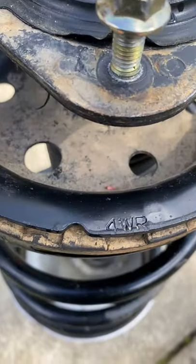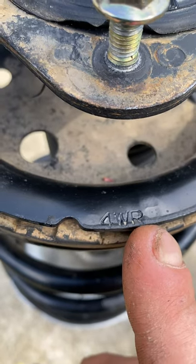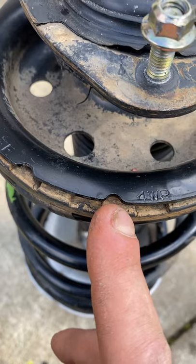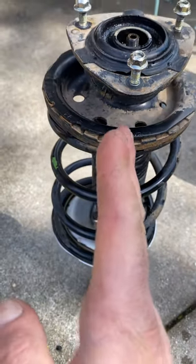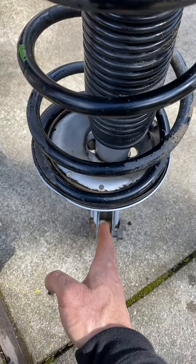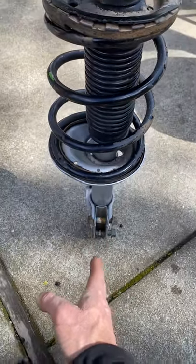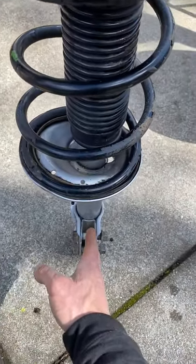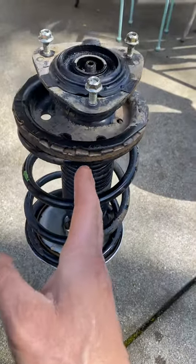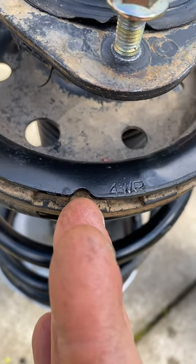Just a quick little example of how you want to line these up. This is for the rear right side — there's a little notch right here, right next to it. That little notch is in a perfectly vertical plane with the two mounting bolts and the mounting face that slides into the rear spindle. So basically, line up that lower mounting plane, go perfectly straight up in a vertical plane, and that should line up with that little notch right there.